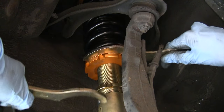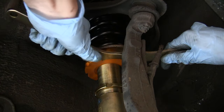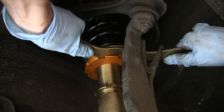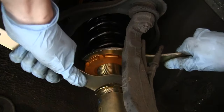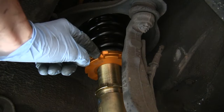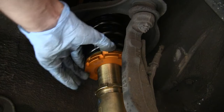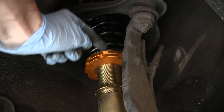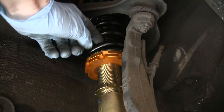You're going to have this one on there, this one in here, and then you're just going to press with both arms and loosen that spring. Once you've loosened the spring, you can turn this upper ring and that'll actually compress or stretch out the spring so you can get it to the desired preload that you want.